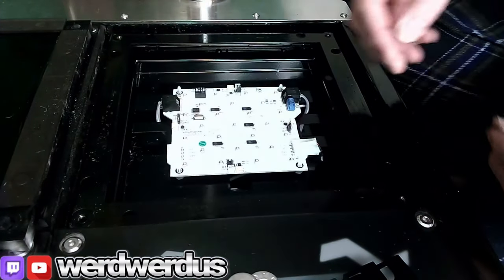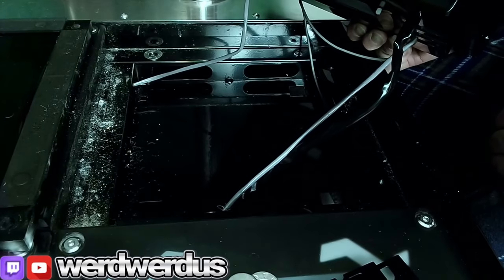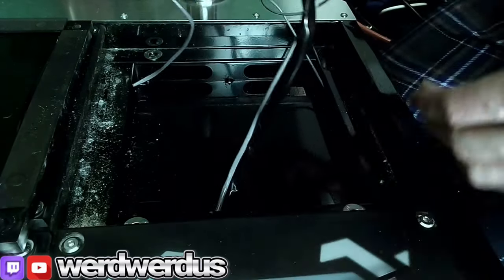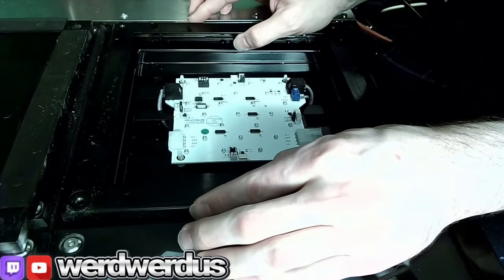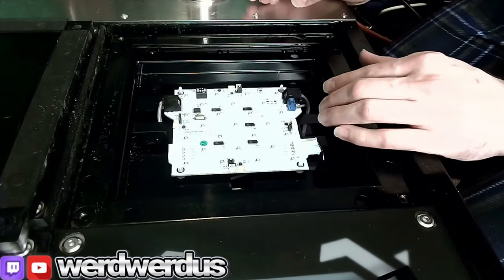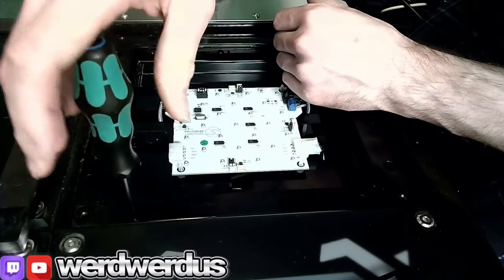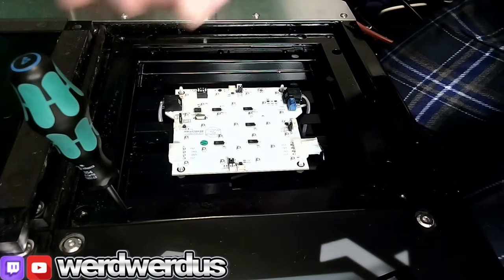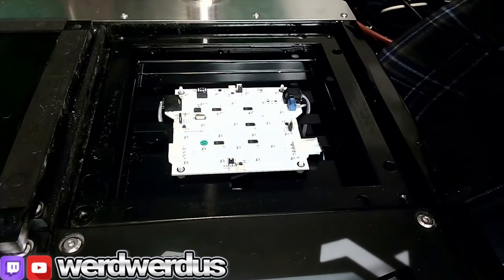If you're going to use washers, put the washer over the hole where the panel frame screw goes in — you need to put all eight down. Then carefully set the frame down and make sure the washers don't move because they have to be lined up with the holes. You can stick something down through the hole to keep it aligned, like a smaller screw or a little screwdriver. Then just replace the screws and that will have it raised up.